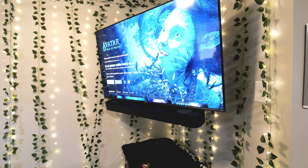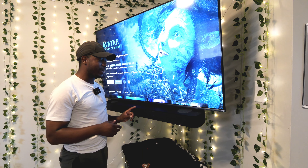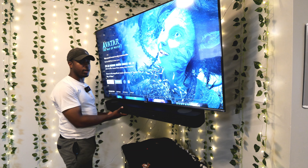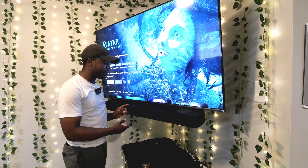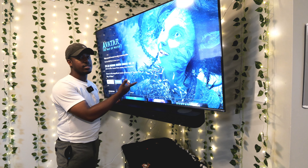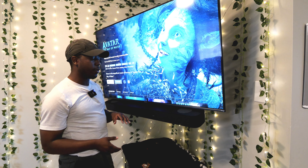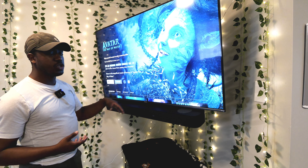The TV is back on the wall and the soundbar is mounted as well — it wasn't a really hard process. My soundbar is super wide compared to the mount; I will admit I didn't pay attention to how wide my soundbar was versus the mount I chose. My mounting points were a little bit wider than what the bracket was suggesting, but I was able to get it up there nice and safely. I forgot to bring the soundbar remote with me, but I do have the ability to hook it up via HDMI ARC, so I can use the existing TV remote to turn the volume up and down and turn the soundbar on and off. The only thing I can't do is adjust the bass the way I'd like to, so I'll bring the remote next time.